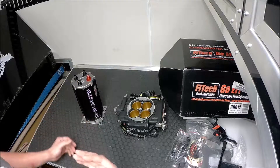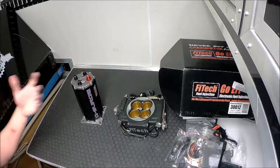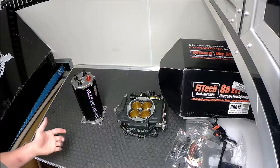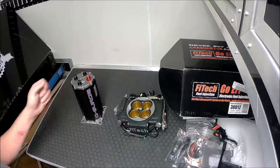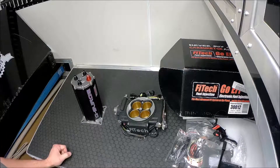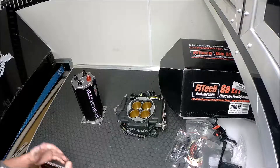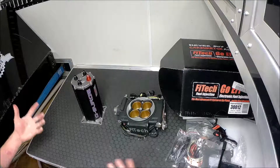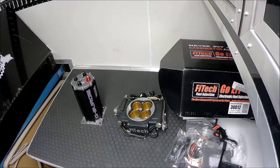With the dual pump at $400 you've got 1,600 horsepower capability and two pumps. So you don't want to run both — just cap one off, and if a pump fails for whatever reason, you just swap your wire positive to the other positive and move a hose, and now you're back up and running. I looked at it from that perspective. Everybody's got their own opinions and this is just mine. I'm just trying to give y'all a little more information than I was able to find on the internet for this stuff. Anyway, take it easy — this is Street Power, we'll see you next time.